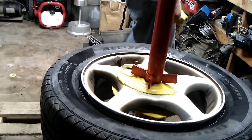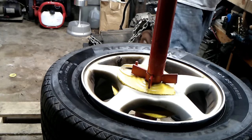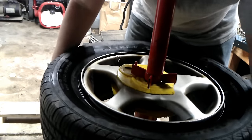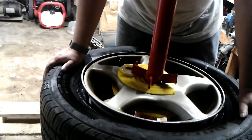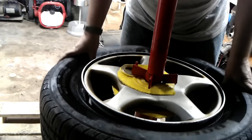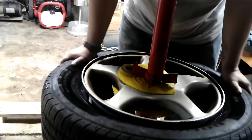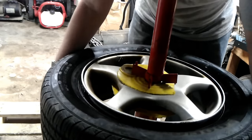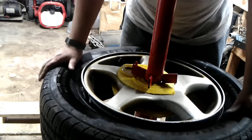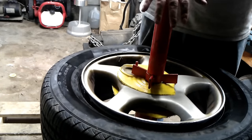That's really it for mounting. Now the next part is inflating it. On a regular tire machine you lift the tire and step on a button to blast air underneath to seat the bead. This tire is a bit floppy but the bottom bead is pretty well seated, so it should pop on — but that's going to be the next video, where I pop this tire back on the rim using one of those inflator blast tanks.